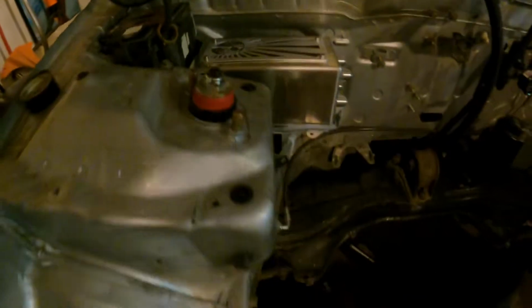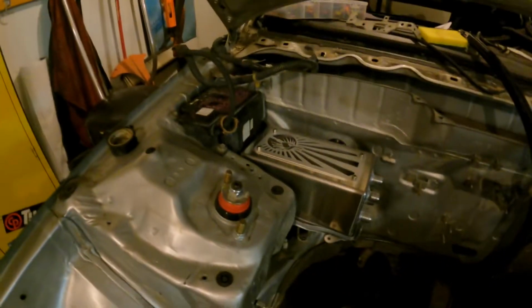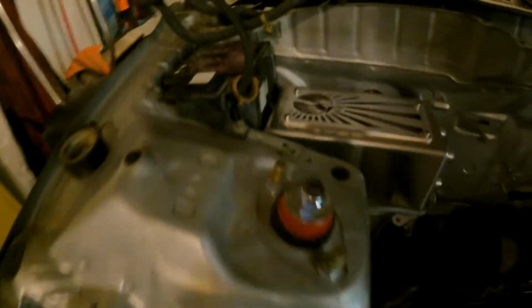Go closer here. It's underneath the fuse box where it comes in. I have billet plugs to plug that grommet back there if I were to actually pull the harness into the car. Normally you cut this boot out and you just feed the wires through here and then run it down on the fender well here, but I didn't feel like cutting this up.